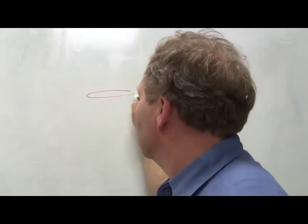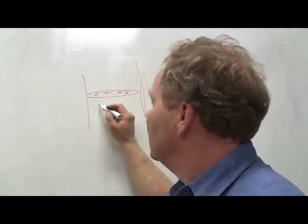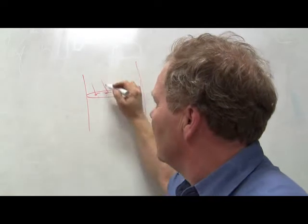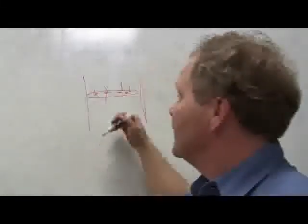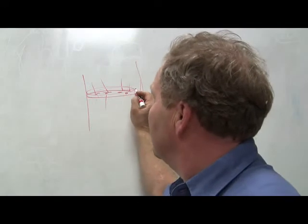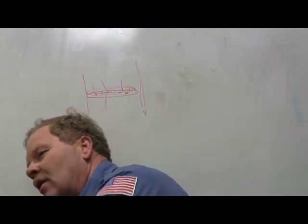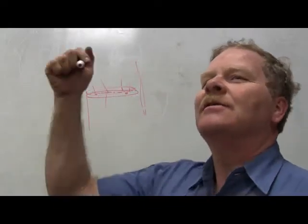Okay. All right. The off-road switch lets the driver activate the air suspension to raise the vehicle a calibrated amount. Not only are we stiffening up the shocks, and you do that, it changes a little valve inside the shock. They got oil going on a shock absorber. You got a shock absorber with a bunch of holes in it. This glycerin stuff, or whatever they got in it, oil that's in this shock absorber, has got to go back and forth between these holes in order to get from one place to the other as the shock's working. The ones that got ride control will have two sets of holes in here that when they're lined up with one another, the shock is kind of soft, and when you move it so half the holes are stopped up, it's harder.